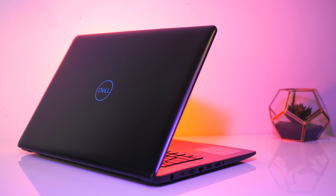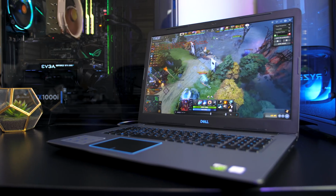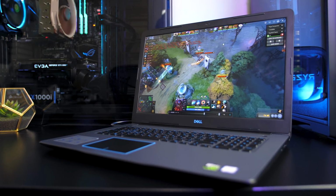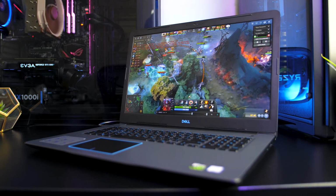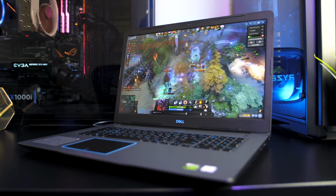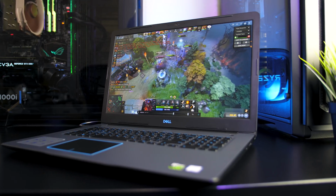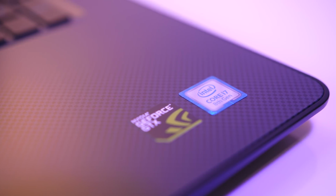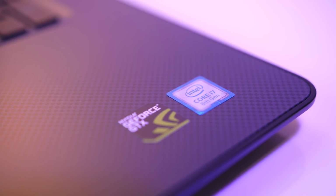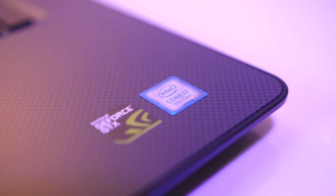While you could probably improve the temperatures by swapping out the thermal paste, that's not something I can test in a review unit. If I go ahead and remove the stock thermal paste and replace it with my own, I can't put the old paste back. So the next reviewer would experience something different from what you'd actually see with the product and unknowingly report incorrect information due to what I've done. Although, with that said, power limit throttling was more of an issue from my testing than heat anyway. But perhaps thermal throttling could become present in a warmer environment.